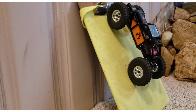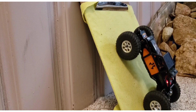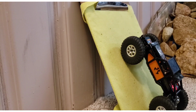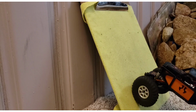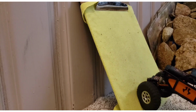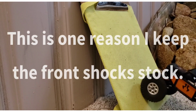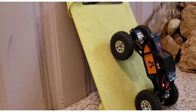either, because just the fact that you're putting torque on the rear axle to push forward is going to cause that front end to want to sort of wheelie, and without the ability to flex out, it's not going to wheelie. Just for fun, in the same shot, I'm going to now take the front ones off and show you what happens with same angle. Haven't changed it, except now I've allowed the front end to rise. So I've got front end torque rise. You can see it's already having trouble. See that? Hyperextended. And now it can't climb.